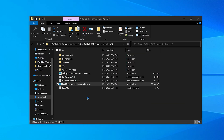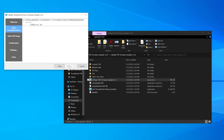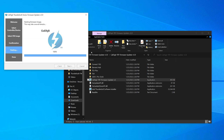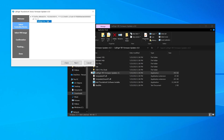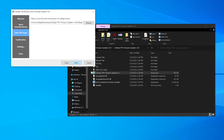Run the program Intel Thunderbolt Software Installer to install and update your Thunderbolt drivers. After that, restart the computer and then launch the program titled CalDigit Thunderbolt Firmware Updater to update the TS4's firmware. Follow the installation instructions and when it's done, power cycle your TS4. When it turns back on, the TS4's firmware should now be updated. You can double-check the firmware version by launching this program again and clicking through until you see the firmware version listed.